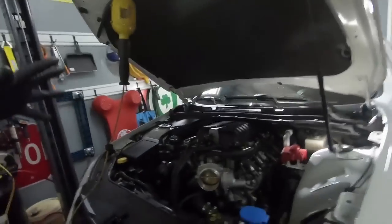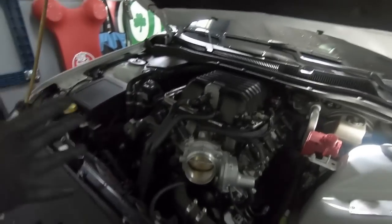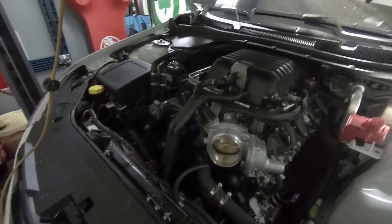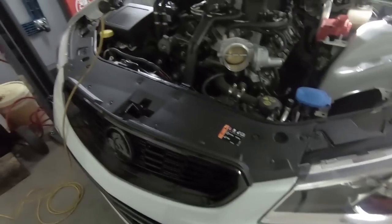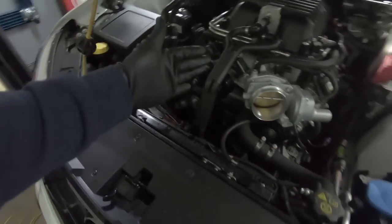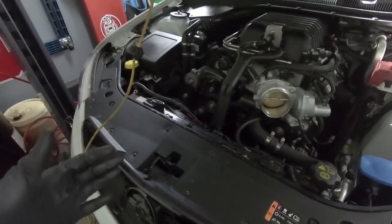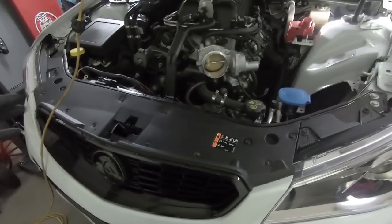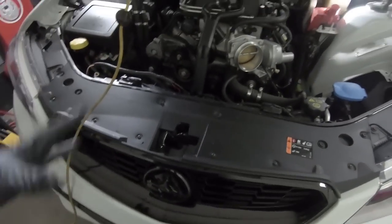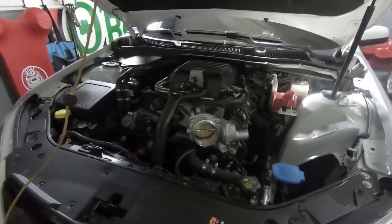So in the next video on this thing, we're going to get the blower off, maybe get the heads off, all the front drive assembly, and maybe we can leave the bumper until the very last. We're definitely going to have the radiator out and the fans out in order to get the actual cam slid out far enough, even if we didn't take the front bumper off. But because of the heat exchanger, I'm going to have to take the front bumper off, I'm almost positive. But that's not a huge deal.